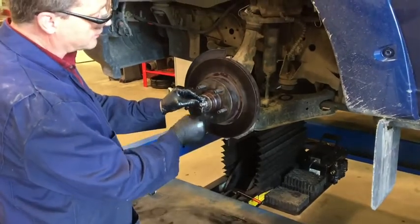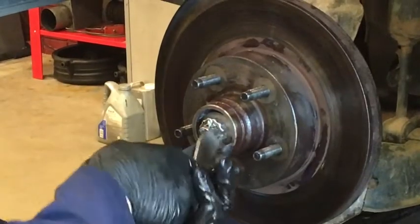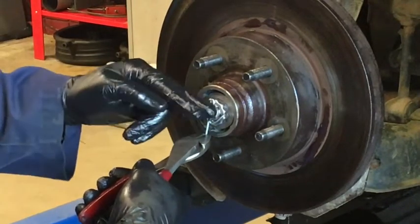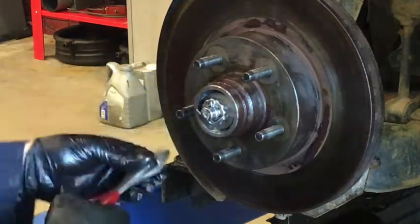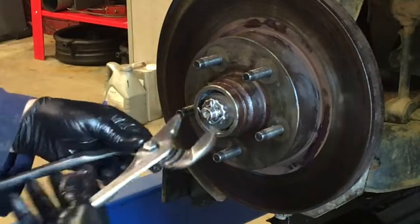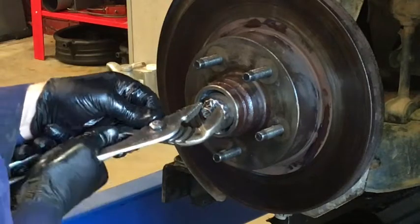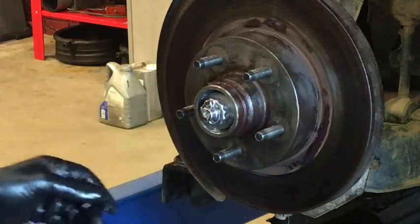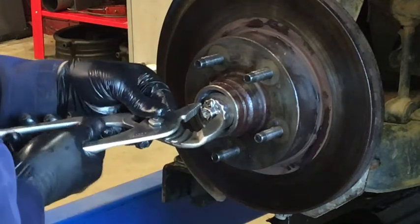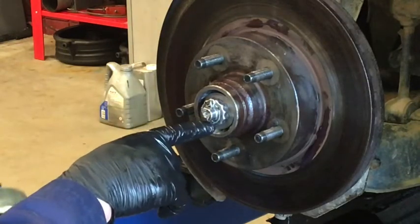There we go. So with a castle lock, we're going to take our cotter pin pliers and bend them around like so. If this was a castle nut, remember you're going over the top, cutting the excess off, leaving it nicely overlapping on the spindle for safety, and cut the excess off the bottom. Sometimes I grab another plier to shape it — slip joint pliers work a little better. I want to tightly push them up around the spindle. I do not want the cotter pin ears sticking outside of the cap, so it's important to shape them nicely so they stay secure. If they're sticking out, it'll grab the cap and potentially affect how that cotter pin is doing its job.